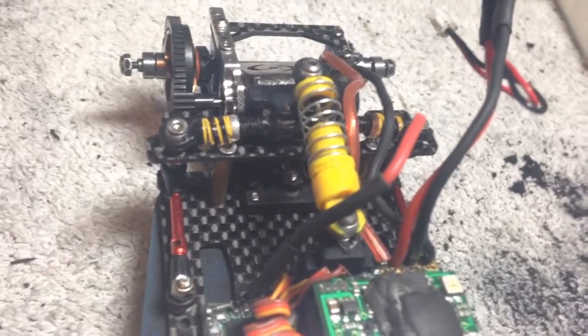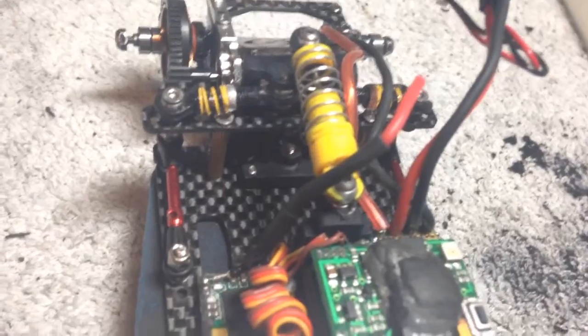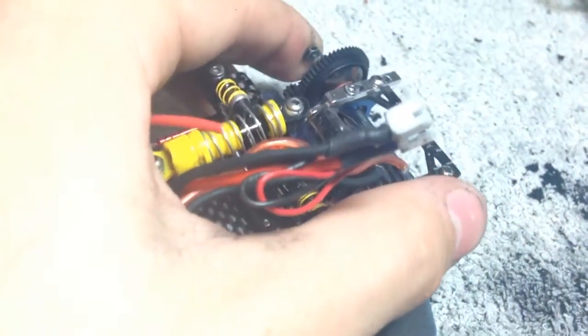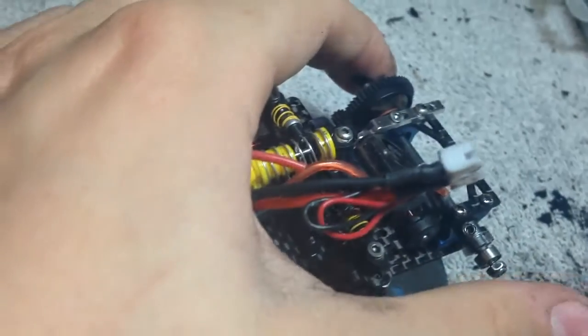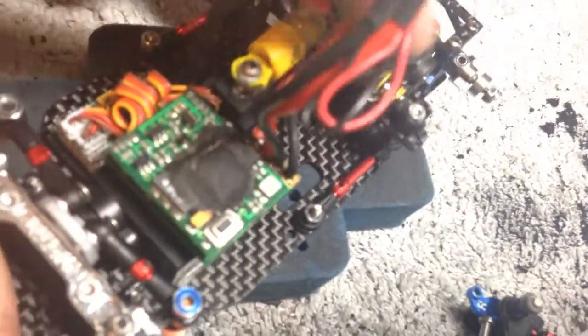like me. At the side, we're running these PN low profile tri-shock springs, and basically to set your preload, if you don't want to use those drip screws, you're gonna twist your pod. You're gonna articulate your pod all the way to the left, like so, all the way one way, and then you're gonna adjust your nut so that it just touches the spring. So basically, let's see if I can do this one hand. Nope, that's not gonna happen. Oh crap. Let's do over here.